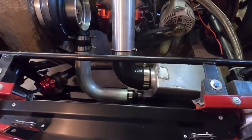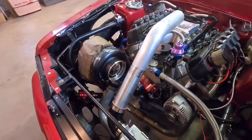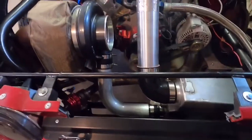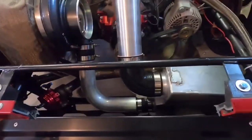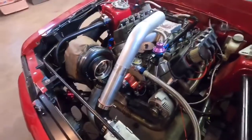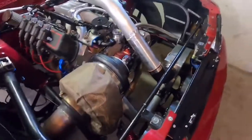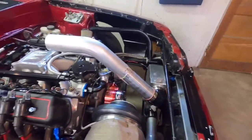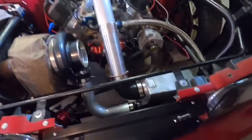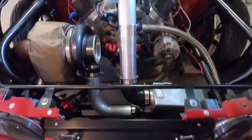I got the little 90-degree coupler here, which works out perfect like I thought it would. I am against 90 couplers — this section here will be welded. I just don't like the way 90-degree ones look, but the way this worked out it was the easiest way. I might change it with V-band clamps later, but that's a lot more work and I'm trying to make the April 18th deadline to get this thing running for chassis certs. It fits perfect, and silicone couplers versus V-band clamps makes no difference on power — it's all visuals.